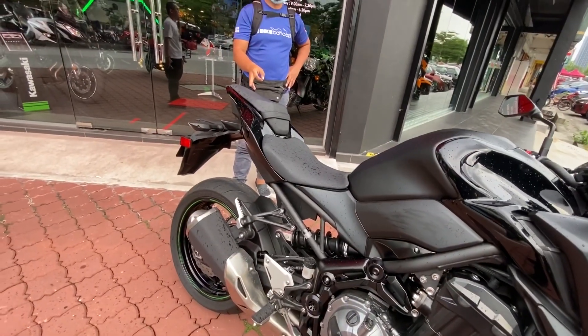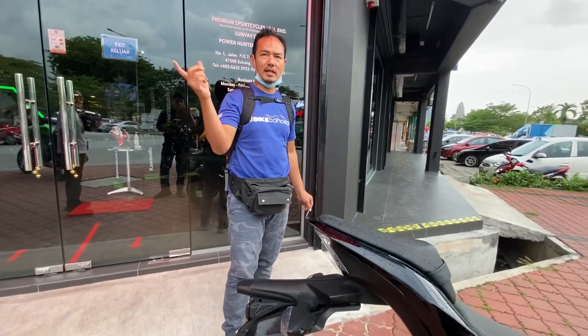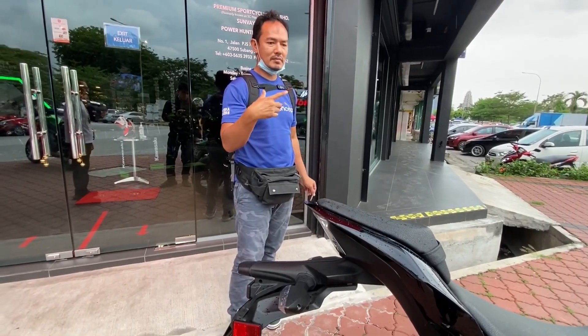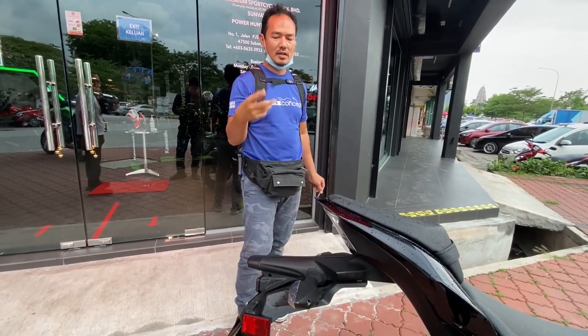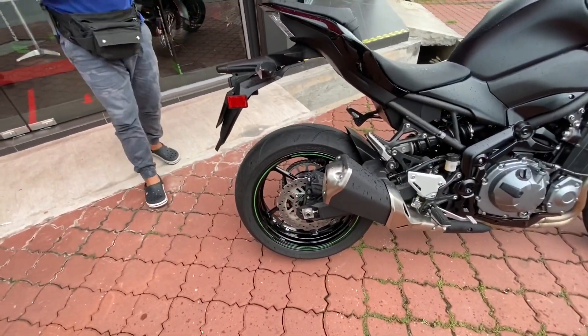Let it eat nicely, slowly slowly, touch. Not hard braking — when you're riding, just touch the front and back brakes lightly, let them bed in nicely over a few discs. Then check back — once the disc is shiny, then you can brake properly.